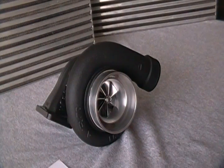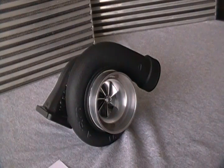The purpose for this turbocharger is to create the ultimate time attack turbo for those in a 1.8 to 2.4 liter class that want to use this in upwards of about 550 wheel horsepower. They don't mind the use of water lines, high boost pressures, high thrust loads, and going over 30 pounds of boost pressure, because this really is a high endurance, highly durable turbocharger. It can also be used for road racing applications from 500 to 650 wheel horsepower, and even drag racing applications up to about 700 wheel horsepower. However, unlike the journal bearing Reaper that this was based off of, the use of water lines is a requirement and not much of an option.